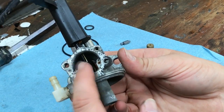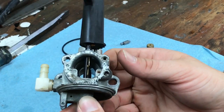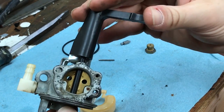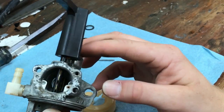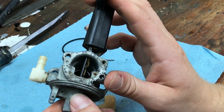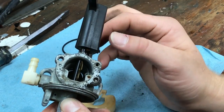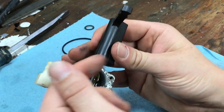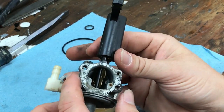You'll see some different types of chokes on different small engine carburetors. This one is a manual choke — you manually position it to whichever position it needs to be in, whether closed, partial, or wide open. This is more common on generators and air compressors. Push lawn mowers will often have a linkage that works automatically to adjust the choke, with a linkage that goes up toward the flywheel, and you just unbolt it from the top when you remove the carburetor.